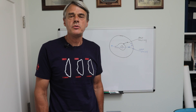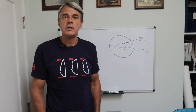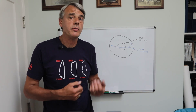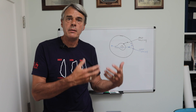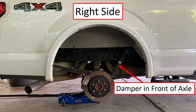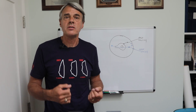Changing the rear shocks on a pickup truck is usually a pretty easy affair. There's a lot of room underneath and the shocks are usually easy to get to. On a truck with a leaf spring rear suspension, you may have noticed something odd about the way the left and right shocks are mounted. In many cases, they are not symmetrical — not mounted in a mirror image of each other left and right. One shock will be mounted on the front side of the axle and tip slightly forward, while the other will be mounted on the back side and tip slightly rearward. These vehicles have what are called staggered shocks.